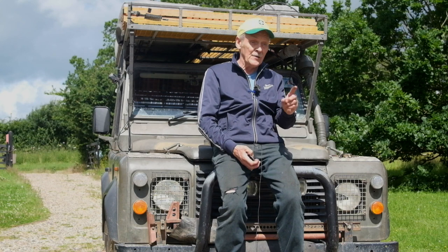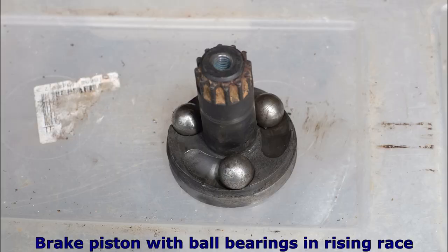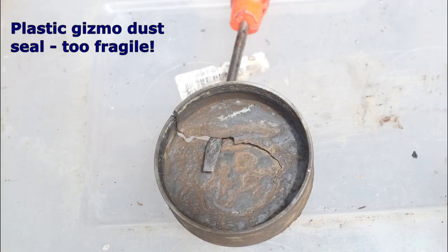I also found that there was a problem with the movable brake shoe which had broken free. This is attached to the piston, but not directly — it's attached to this miserable little piece of plastic which slips over the piston, and this had broken up. Yet again I was faced with the prospect of buying new pads. But by now I was well fired up and the last thing I wanted to do was spend my hard-earned money with Foundry 4x4. I regard their commercial practices as being very sharp — the prices of their replacement pads are a rip-off, a bit like Gillette with their razor blades. That's where they make their profit.